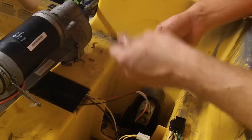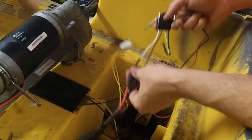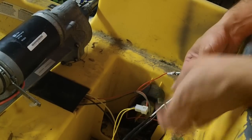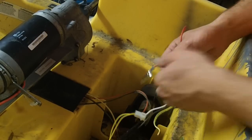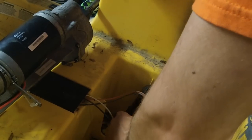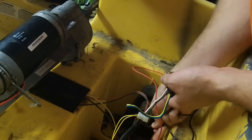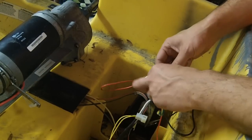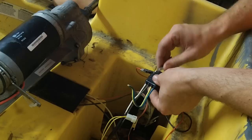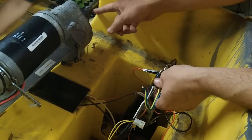As you can see from John's demonstration, the motor turns but nobody's home. So what we've done is soldered this in, put shrink wrap on it, and we're going to clip it off. The clip on that side is going towards what we've deemed our positive, so we're going to clip that to the positive side of the motor. We're going to take our black here and clip that to the black side of this motor, making sure not to hit the case side. Now when John hits the pedal, we should see this turn.